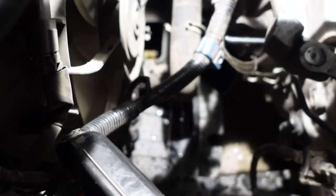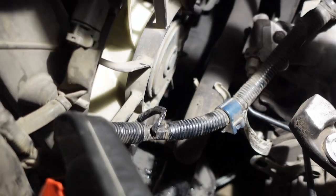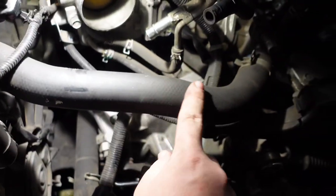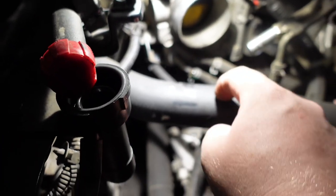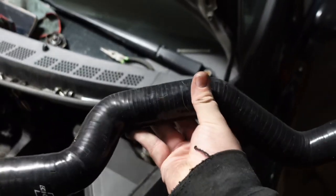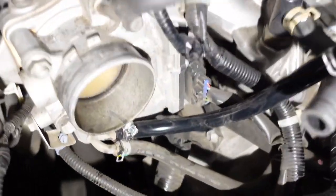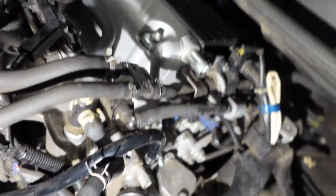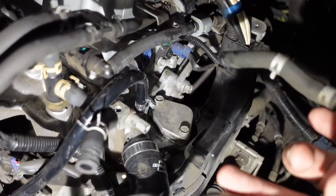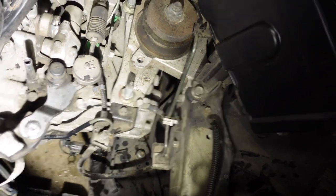Next step: you want to drain your coolant because the coolant line is going to have to be replaced — it's going to get in the way. We're replacing it with a K24 coolant line that was supplied in the kit if you got the optional piece, which you need to. We put the new hose in under the throttle body to replace the stock one with the hard lines. Now we're going to be putting in the battery tray and mounting the intake.